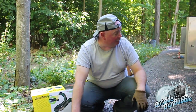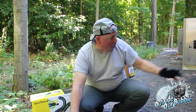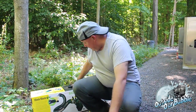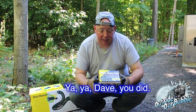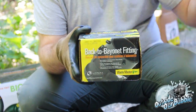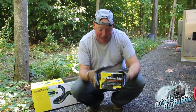So as soon as this is done flowing, then what are we going to do? Say it with me. Shut the black, open the gray. Great. And that will flush out this tube nice and clean. So I'm just watching this to see how it comes out. By the way, just in case I didn't mention it, which I think I did, this is a back to bayonet fitting, which is something that they have, which you can go back to the bayonet just by sliding this into the cam fitting, and then it gives you the bayonet fittings for the old type system in case you ever had to do that.